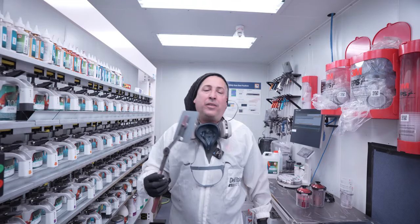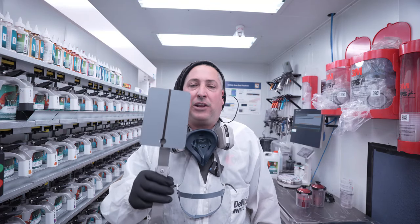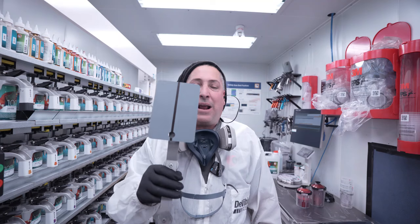Start out, and on this color it is crucial to put down the right sealer. So this one is going to be the L002 in the solvent sealer that we use here, and we've got our spray out. So what I'm going to do is get my card sealed up, then we'll apply our ground coat, then I'm going to finish out the spray out card. That way I know how many coats of the candy we're gonna need to match this.